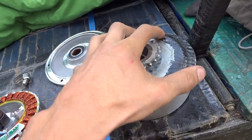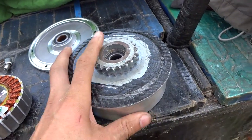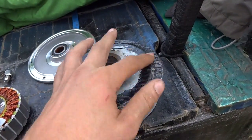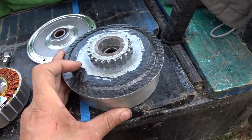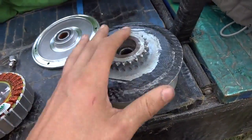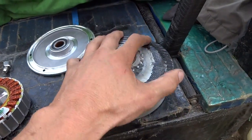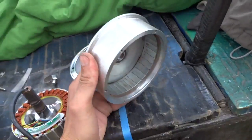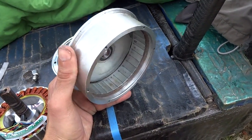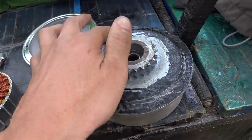At 36 volts you can get more than 250 watts out of them, but the efficiency is only around 100 to 150 watts at 24 volts going uphill. With my 24-volt setup, each motor pulls 250 watts, so together that's half a kilowatt. The torque isn't much bigger but the heat is significant — I'd guess efficiency is only about 50 to 60 percent.